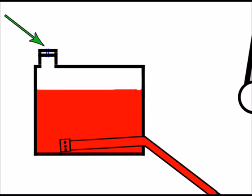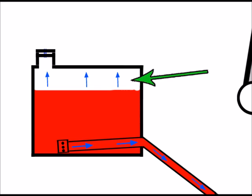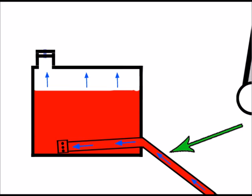Now, when these valves fail to work, which is something I have come across a few times in the past, the fuel can't leave the fuel tank because there's like a vacuum lock there. There's no air coming in to replace the lost fuel. And the effect there would be kind of like if you had a large syringe and you had no needle on it, of course, and you put your finger on the top of the syringe and try and draw back. You wouldn't be able to do so. You wouldn't be able to pull back. And if you did manage to pull back and let go, it would spring back upwards. And that's because of the vacuum, the air drawing it back up, because there's no air coming in to replace the air you're trying to draw back out of the syringe itself. So the vacuum lock's created and actually pulls back up at the fuel, just like when we pull back at the syringe and it springs back up.